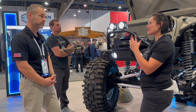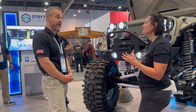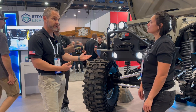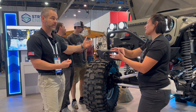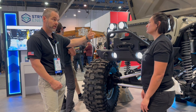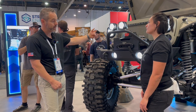So my question is — it has a diesel and it's an EV. Doesn't the diesel make it confusing? One of the questions I get a lot is: is this a hybrid? To me, a hybrid has a mechanical connection between the internal combustion engine and the drivetrain. This does not. Think of this as an EV with an onboard generator. The battery is the primary source of drive to the EV motor. But there are two motors — one paired to the back of the diesel that generates electricity, and another IM425 run into a transfer case that transmits power to the rear axle and one to the front drive shaft. So is the diesel on all the time or only to charge?